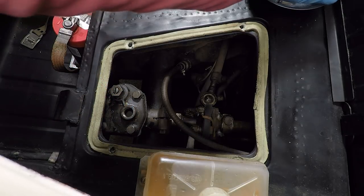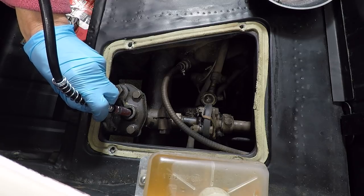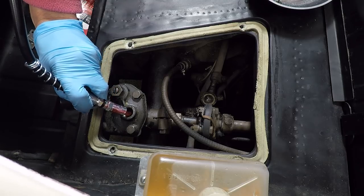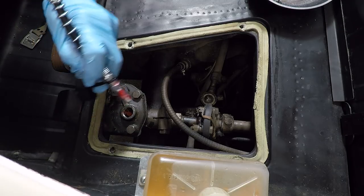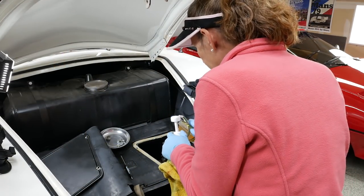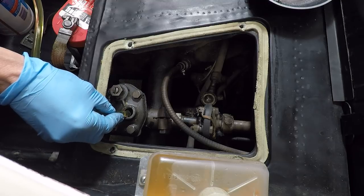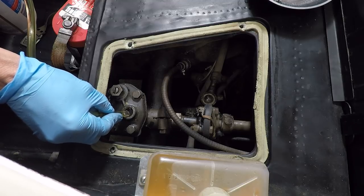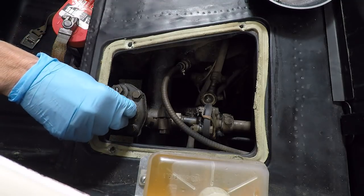We're pretty low in there. I'm going to add a little bit of grease and then a little bit of oil. The hope is it'll leak a little less but still stay lubricated. I think that's about all the grease I want to put in there. I'm going to go ahead and top it off with the same oil we used in the transmission — just to bring it up. That looks pretty good. Go ahead and put our plug back on.